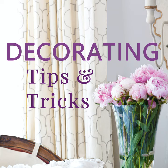Spray the degreaser on and wipe it off with a non-lint white cloth. I tear up old white long-sleeve t-shirts, or I have a big box of white t-shirt-type rags that are non-lint. Then take a spray bottle and go over the whole thing with water and wipe it down. You don't want any dirt, grime, grease, or residue on it — it will inhibit how well the paint adheres.